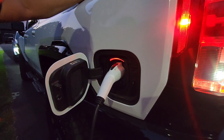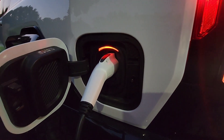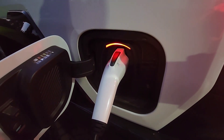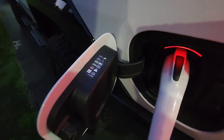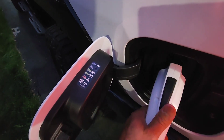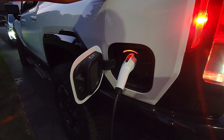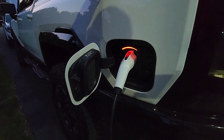It's red. Let me find out what's the deal here. With Tesla there are no issues, but the Hummer might be a little more picky — it wants an actual 60-amp. Let me check. It says 'amber solid' — problem external to charge cord, check wall receptacle and vehicle connection.